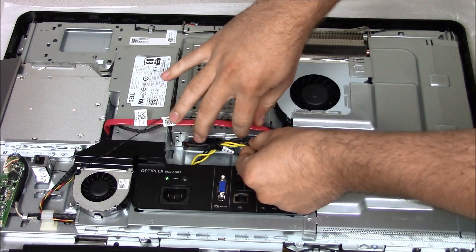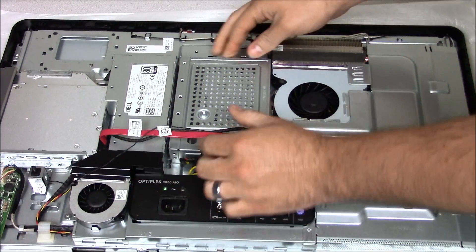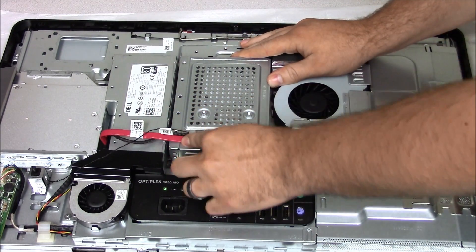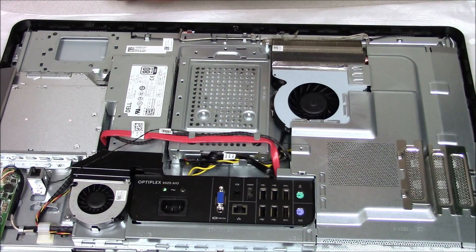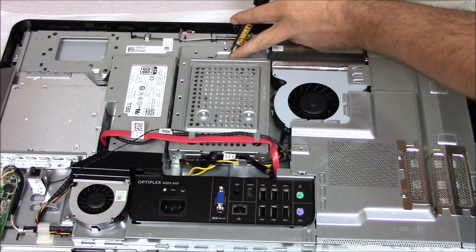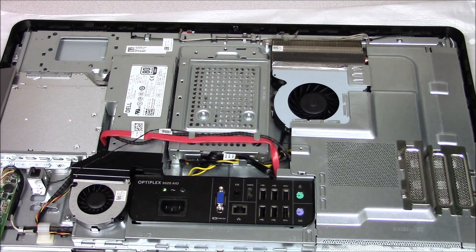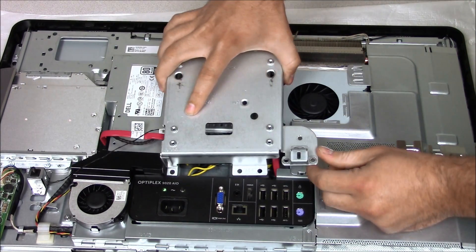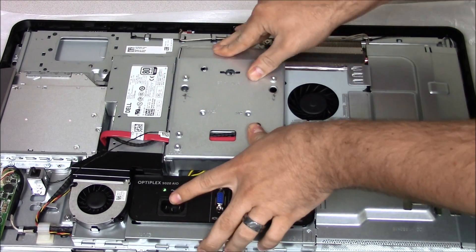Because it is a very small, compact area. We don't want to crush any of the cables as we put stuff back together. So make sure everything is put back in their little hooks as best as you can. Okay, screw it back in. Make sure none of the cables get pinched as you put this cover on.